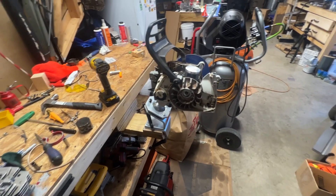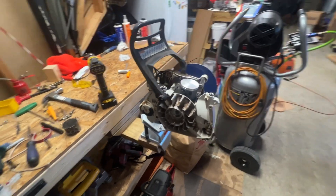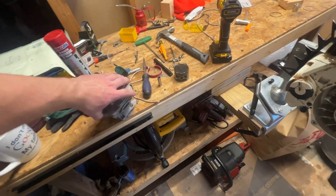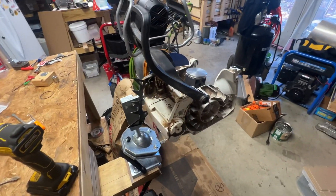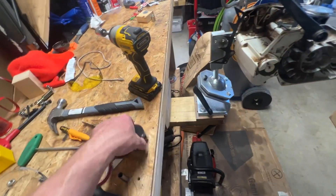The main reason for doing this piston swap — besides the design — is that I was able to hit 65% of the bore as far as the exhaust port width. That's my main reason. Then the wear properties of a full circle piston versus a piston more like this standard design are also a factor.